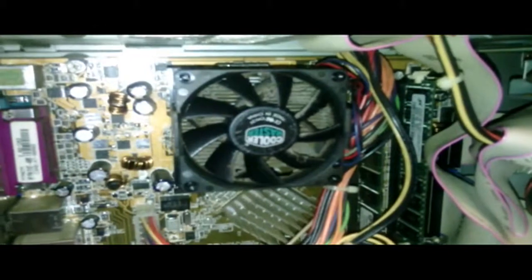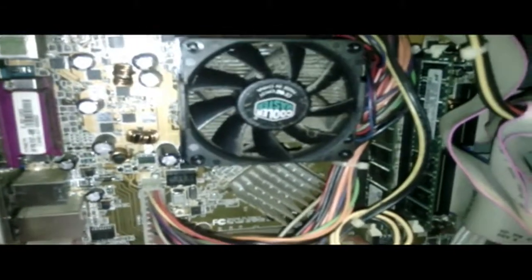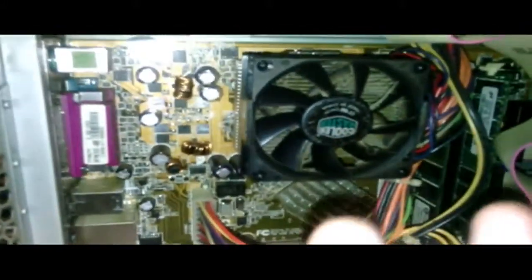The next thing I do is look around at the capacitors on the motherboard. I look at the very top of them — the silver part. If there's a large bump or it looks like a hill, or they're puffy, or there's stuff coming out of them, then I refer to it as a blown capacitor, meaning the capacitor has failed and it's causing a short in the motherboard. This can have any number of effects — from random blue screens of death, the computer powering off for no apparent reason, and abnormal operation, to even the computer not powering on in the worst case scenario.